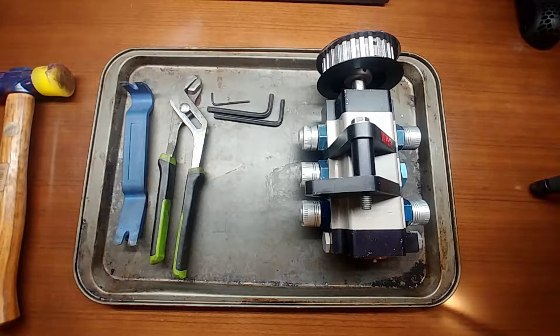Welcome back. This is something I've been really looking forward to because it's a major integral part of what I'm going to do. As you can see, we have a dry sump oil pump. If you're going to do any sort of hard endurance racing, a dry sump is an incredible thing to have — it has so many benefits. Frankly, compared to a wet sump, maybe the only thing a wet sump can do better is convenience.